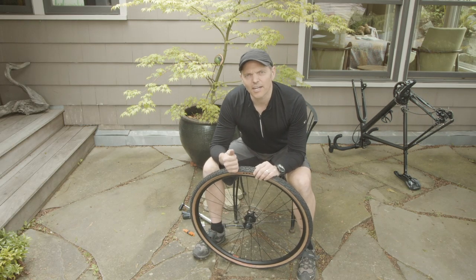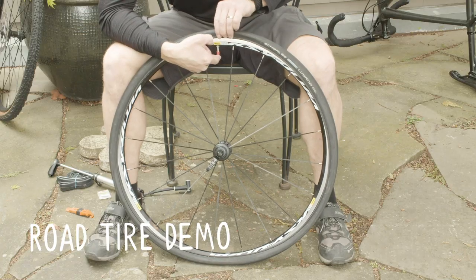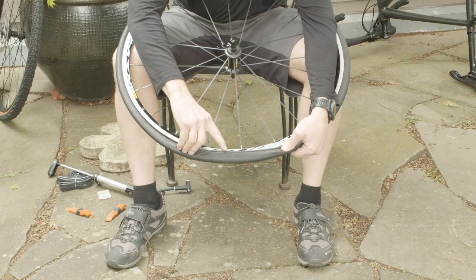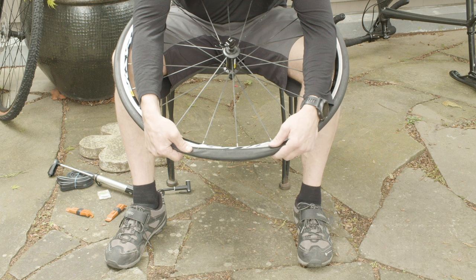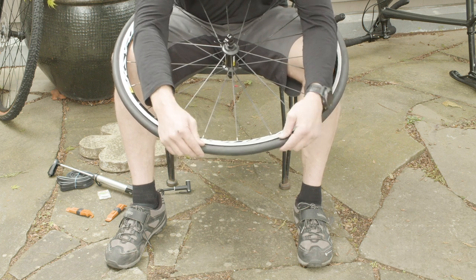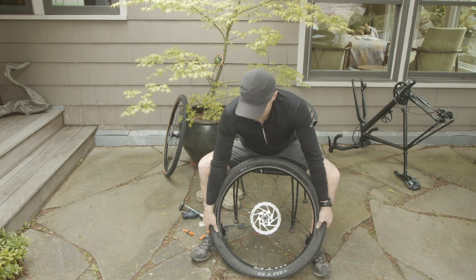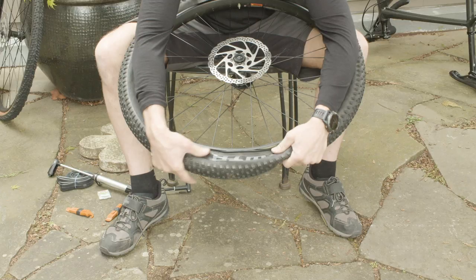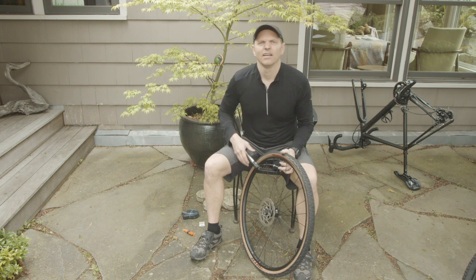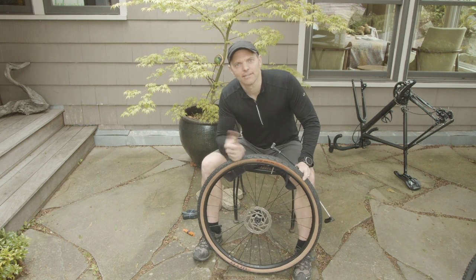Let me show you how to do that on both the road tire and the mountain bike tire. Road tire: push up on the stem and get the tire seated in the middle of the rim — I could use a lever for that, but I'm just going to keep going with my thumbs a little at a time, just rolling it, rolling it, and there it goes. Mountain bike tire: this one's a little less important to push that stem up — and we're there. Back to our first tire: I'm going to pump this thing up. Fixed, good as new.